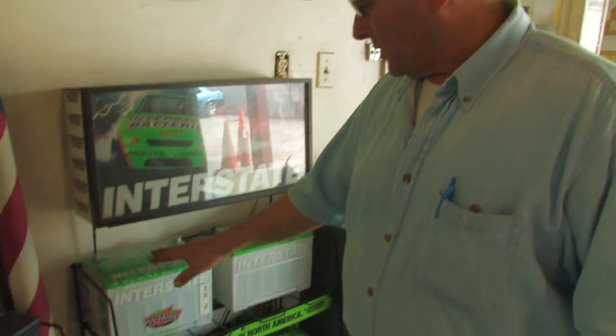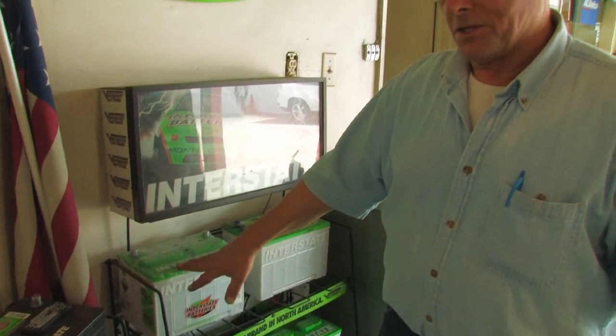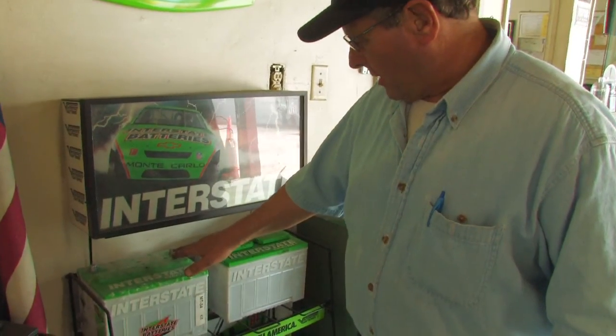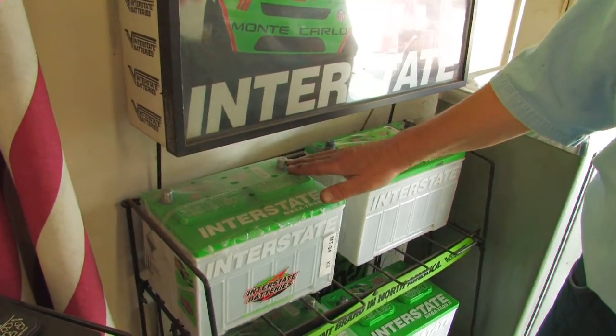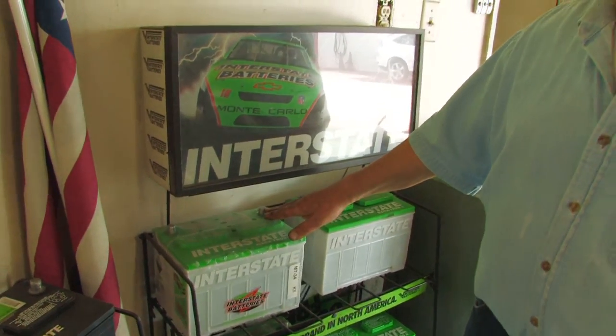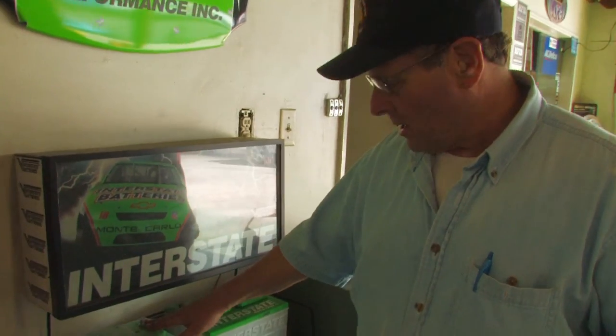You might notice I said automotive storage battery. Basically, the battery as it sits here is doing nothing but storing the essential elements necessary to produce electricity when you complete a circuit. On top of the battery, we have a positive post and a negative post. The positive post is slightly larger — that's labeled plus. That has to be connected to the car's electrical system using the positive battery cable, and the negative post is ground, which has to be connected to a metal part of the car on the frame or on the engine.